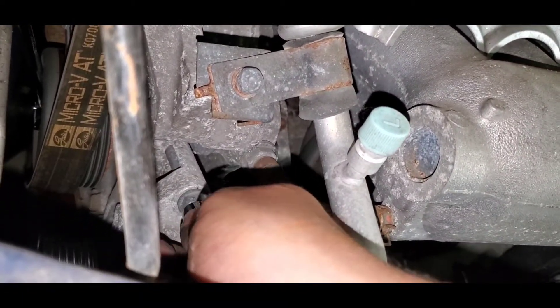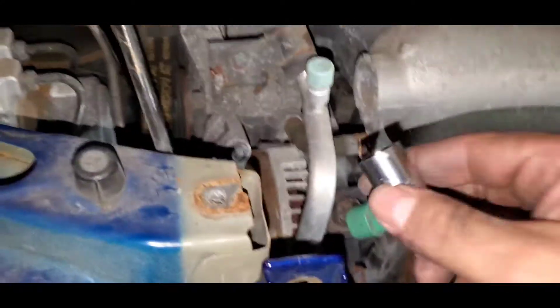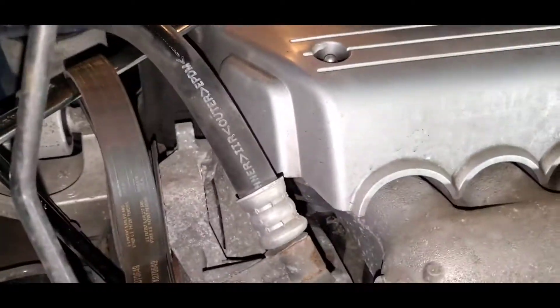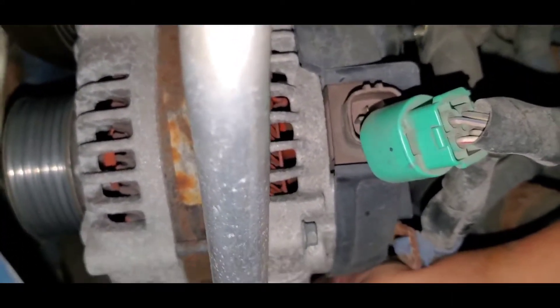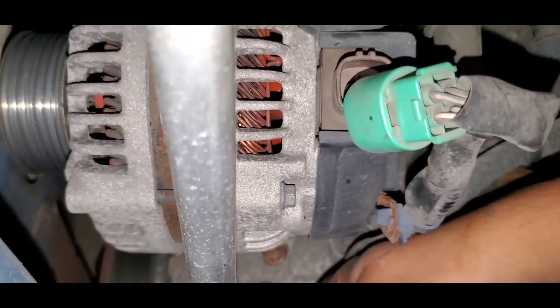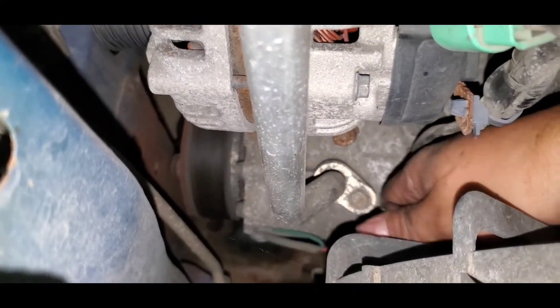Just to make sure, it's not a 10 — it's going to be like a 12. It looks like it's a 12 millimeter. 12 millimeter — fits good. Let me try the bottom one. I guess this is why you need to remove the whole thing — it also fits. That's why you need to remove all this right here, because it's hard to get to these two bolts. It still looks really tight. We also need to remove this unit, the fan, because we need to slide out the alternator through here, because that thing is fat.